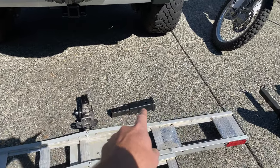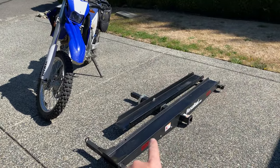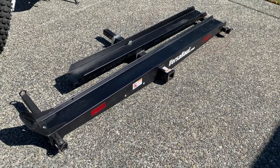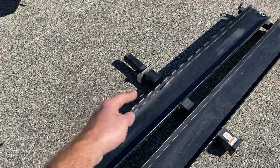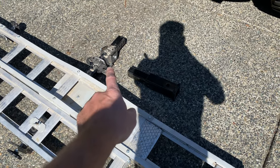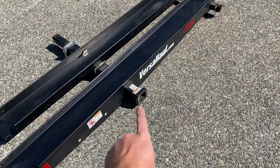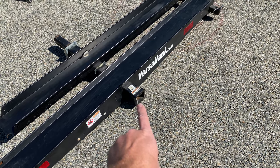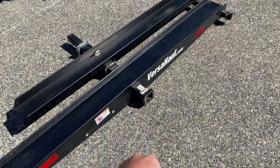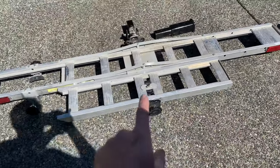With the Harbor Freight you're going to need to use an extension that goes into your hitch receiver. With the Versa Haul you're not going to have a problem — you'll have plenty of room because the bike is going to be seated to the back of the carrier. There are also some stabilization features on both, but there are differences in how they mount. What's really cool about the Versa Haul is you still have access to do your hitch receiver, so you can put on a bicycle rack, a small trailer, or something like that. The Harbor Freight does not have that.